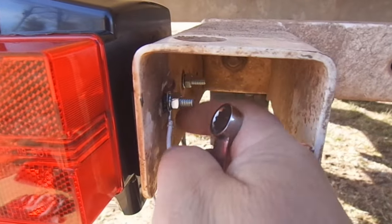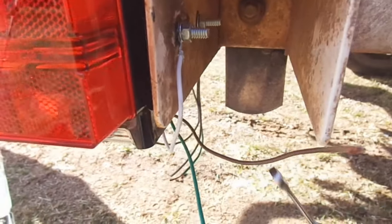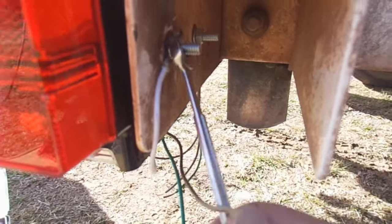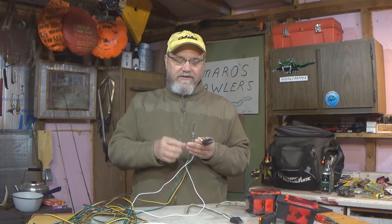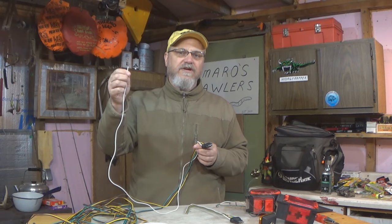Okay, so then when the voltage comes down, say that brown wire again, down the brown wire, out to the fixture, through the fixture, lights up the fixture, and then it takes that path to ground to the frame of the trailer, then the voltage runs down the frame of the trailer and comes back out on this white wire that's also grounded to the frame of the trailer.